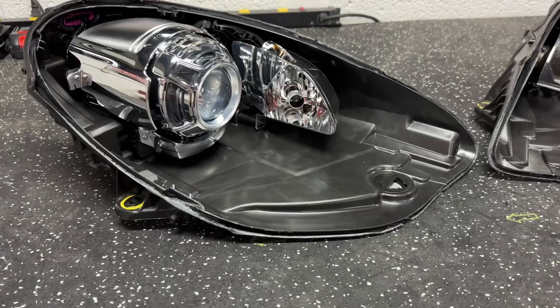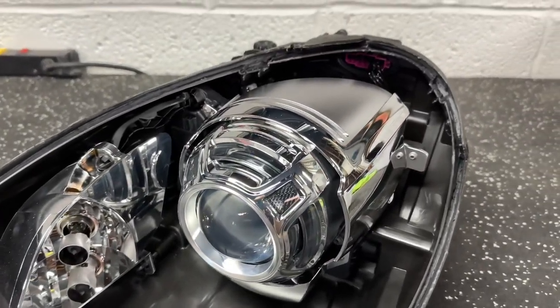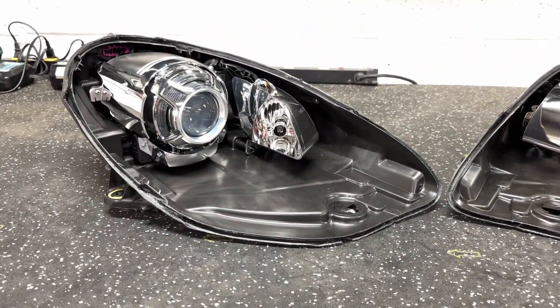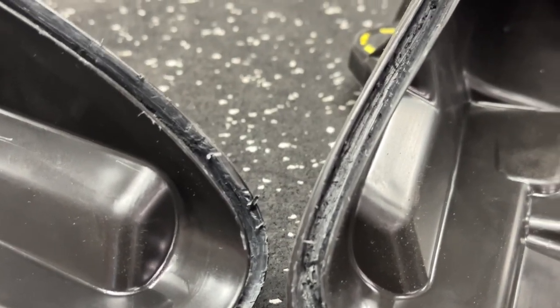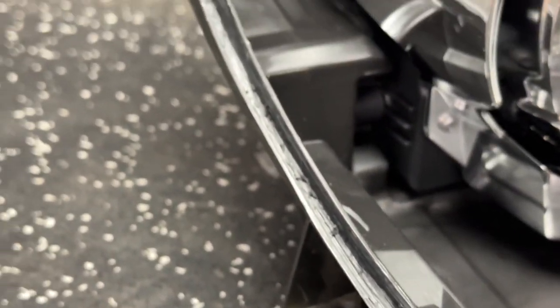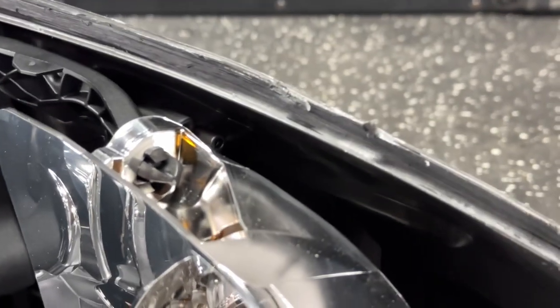The sealant has been fully removed. This is a tedious process, and the reason I'm showing you is because I don't know what other service providers are doing — they could be taking shortcuts, pricing could be different, methods could be different. The number one thing you need to ensure to avoid condensation is a proper seal. To have a proper seal on a permasealed headlight, the channels need to be fully clean prior to adding in your butyl. This is a very narrow channel and you're scraping with special cold glue tools, or a flathead if you don't have them. It's a few hours of back and forth in the oven getting the glue softened up so you can scrape it out.